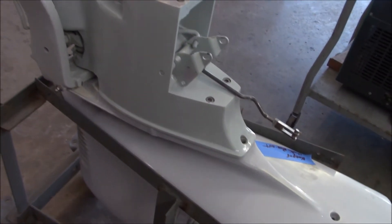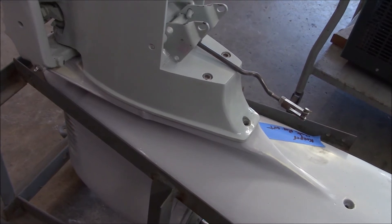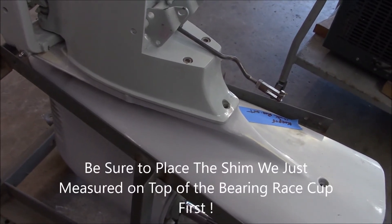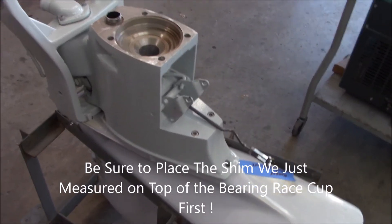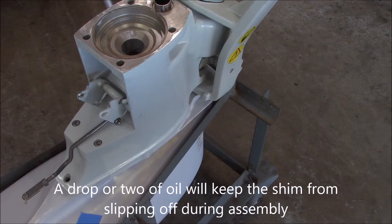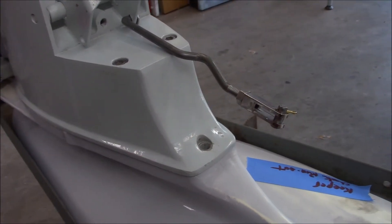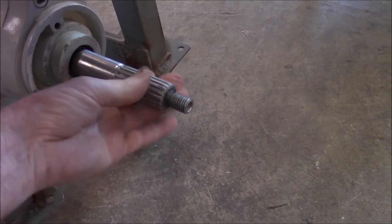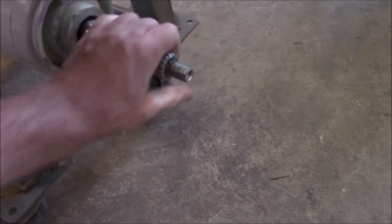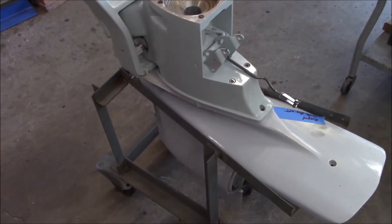Just doing a test fit — no O-rings between the housings yet. The bearing race cup is hard to get out of the lower section after test measurements, so it's easier to put the intermediate section on carefully, draw it down, and then it should stay in the upper section when you separate the halves. As you bring the housings together and draw them down evenly, keep turning the propeller shaft to make sure nothing's binding, and check the backlash as you go — you can feel or hear it. We're all the way down, still have a little backlash, which is perfect. Now we'll separate and do the final seating of the bearing race.